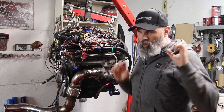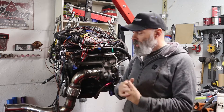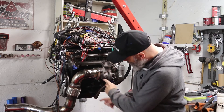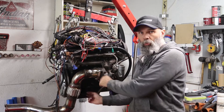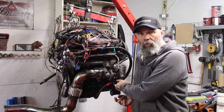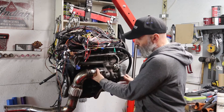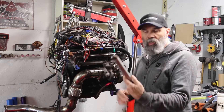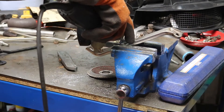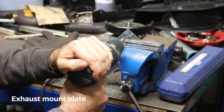There's been a lot of fiddly little things like making gaskets using paper gasket material that's oil and waterproof. The bit I'm going to show you now is making a brace. Ordinarily it's done from the bottom and up under the turbo, but because of the way I've clocked the turbo the mounting points are all the way around here, which isn't ideal. I want to take it from here up to about there just to help support the weight. There's this stainless steel piece here - I'm going to cut across there, move it up a bit so it still bolts in, then look at attaching or modifying this end.